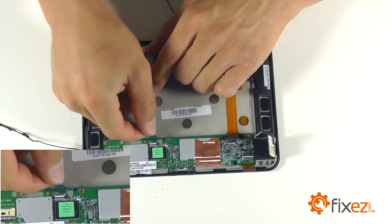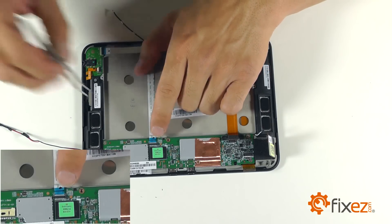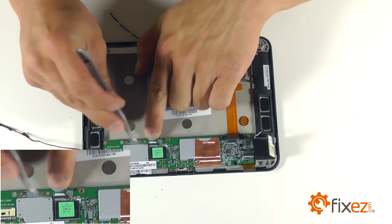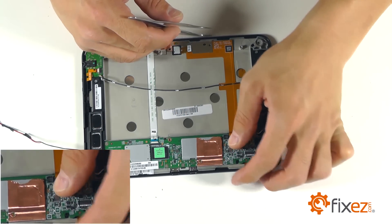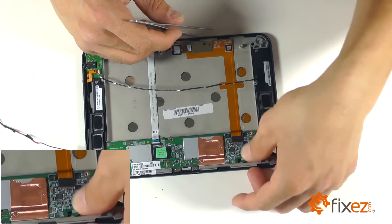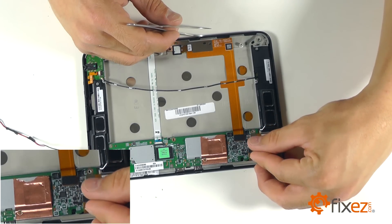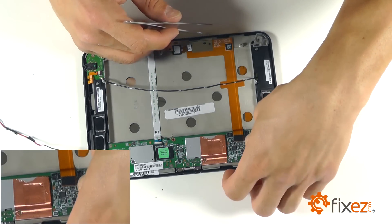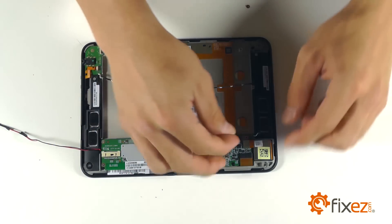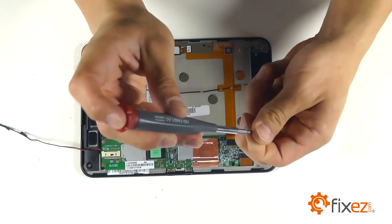All of our motherboard connections are next in line, starting with the ribbon cable for the headphone jack assembly into our locking socket. The rest of our connections are push-plug style that we can secure accordingly. The securing screw in the corner of our motherboard comes with the metal cover for one of our connections — let's not forget this cover plate when we're putting in that corner screw.